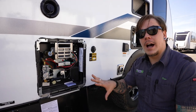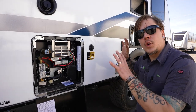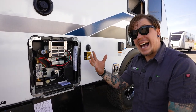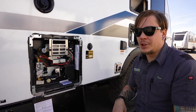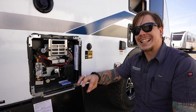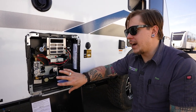Once you are confident of that temperature, we then need to depressurize the water system overall. So with no new water circulating or pressurizing the camper as a whole, we're going to go to the hot side of any fixture. Generally in a unit of this size, you're either limited to the kitchen or the bathroom sink. Once you've found your preferred location, you're just going to open the hot side of that line. What you're going to see there is maybe a little bit of water, maybe a little bit of steam, as that depressurizes the holding tank of the water heater.